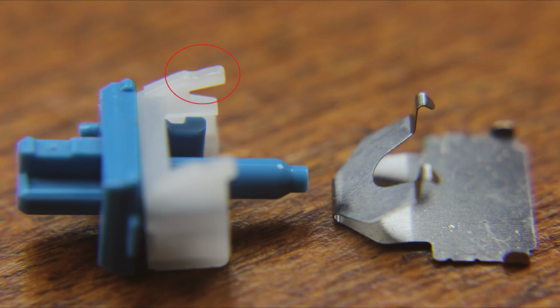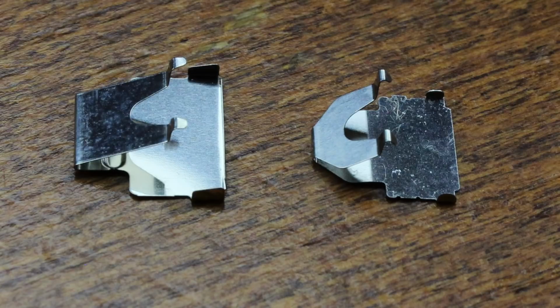Instead of the tiny notch in the slider that MX switches use, which creates more of a scratchy shudder than a genuine tactile bump, the release of a leaf spring like this is a much more singular, defined tactile moment, which is nice. Even if you go for a relatively subtle tactile bump, it feels cleaner and crisper that way. If you look at the design of the leaf spring, it's also very similar to the shape of old Alps switches. In fact, it's much closer to it than I had thought.